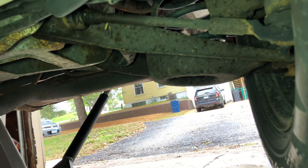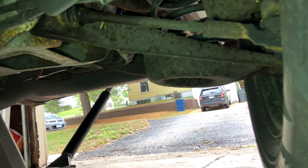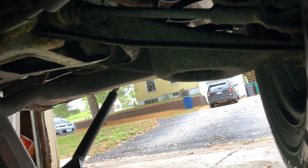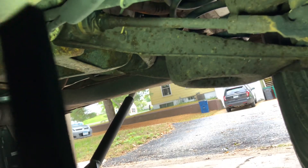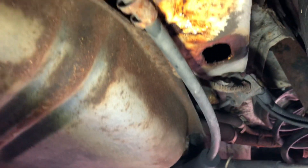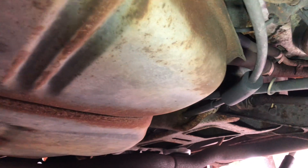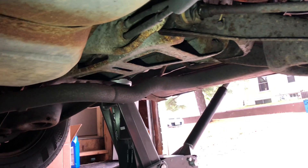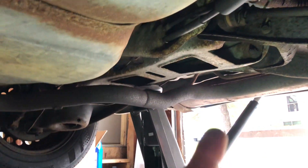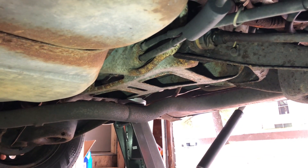In the rear it can be a little bit harder. I've seen videos of people jacking it up based on the control arm back here, but honestly it's not part of the frame — I don't want to damage the suspension. Back here you also have cable lines and brake lines, so you've got to be careful. In my car it's pretty rusted — I tried letting a jack stand sit there and it started bending immediately. The only place I could find that wasn't rusted is right where the jack is, at the end of my finger on the metal frame — the jack stand is so far under the car.